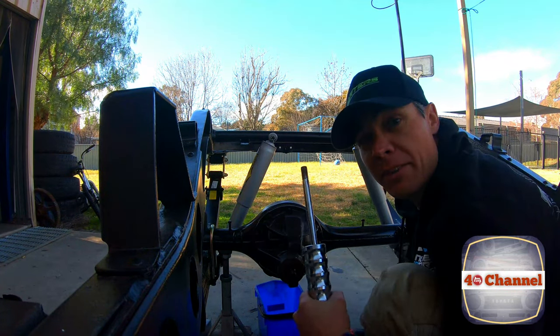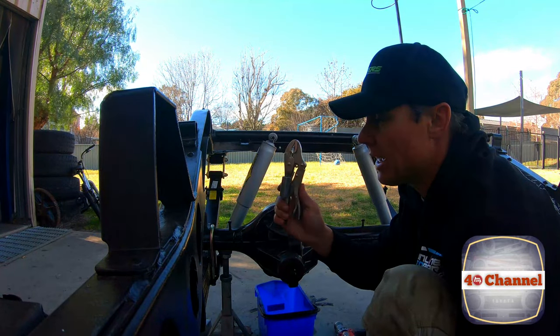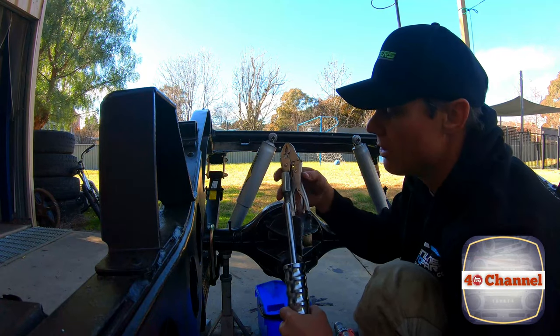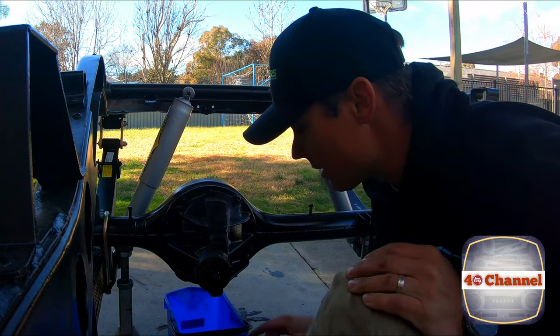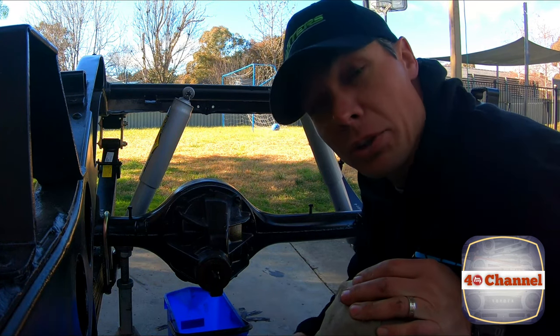Just use my slide hammer for pulling your dents out of your car. And all I did was weld on a nut. Weld the nut on the end of the multi-grips. Screw that onto my end of the slide hammer. Then all we're going to do is just drill two holes. Screw in some screws. Grab it on and just pull it straight off.